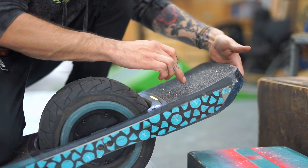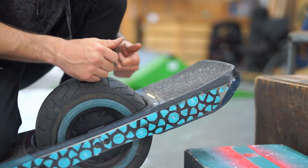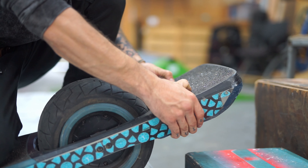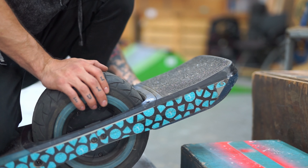So I'm gonna get it at seven: one, two, three, four, five, six, seven. And then to lock those settings in, all you're gonna do is hold down both of the pads for a bit, then turn off your Onewheel, and then turn it back on.